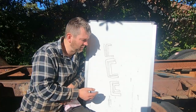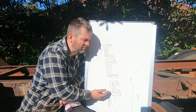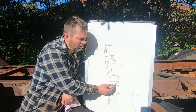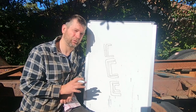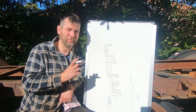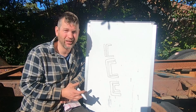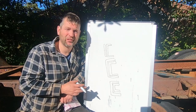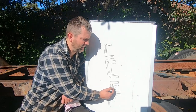And so when we look at the kind of lamination, say in figure 3, this was one of the options that we were considering. Trying to find a C-channel that runs on the inside of the factory Dodge chassis would have been quite difficult because it's obviously a different size. It's not a factory size where you can just go in and buy some RHS. It would have had to have been folded up. The other issue, of course, is the fact that the chassis tapers on the back end. So we decided to scratch that out straight away.